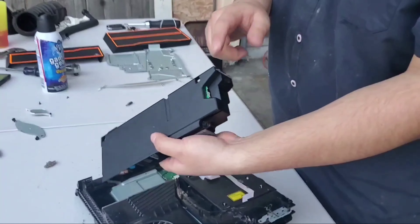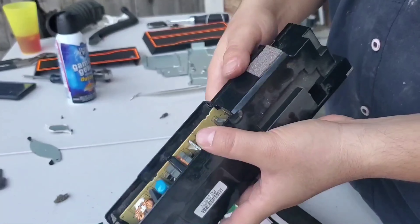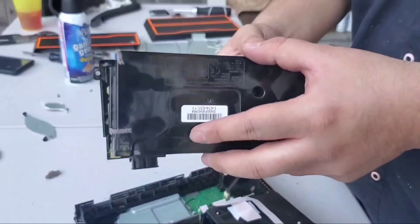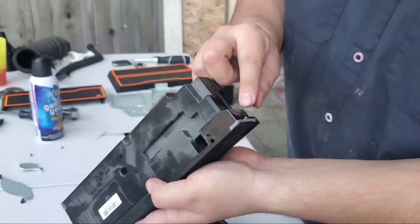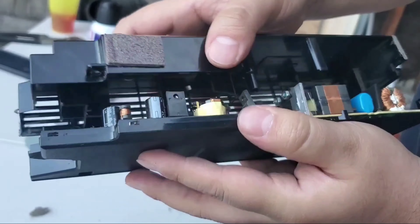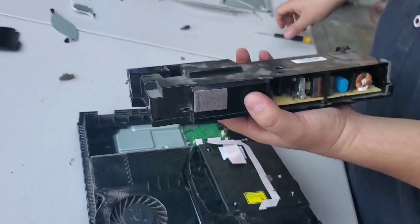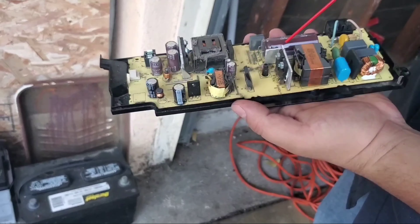I just pulled that out and it came out right from here, and then there's a screw here — Phillips. And then you go all around. I wanted to go inside here — as you can see it's pretty dirty. So what I did is I opened it up. After you remove that screw in there from the middle, there's gonna be a whole bunch of little clip-ons or clips. See this opening here — that one there, this one there, this one there — a whole bunch of little clips holding it. Like this one — everybody can see it? One tiny one there, two here, three, and they go all around. So once you remove that with the little flat screwdriver, I just put it in between the edge — the seam — and just turn it and then it comes open like this. Look at this — super dirty.